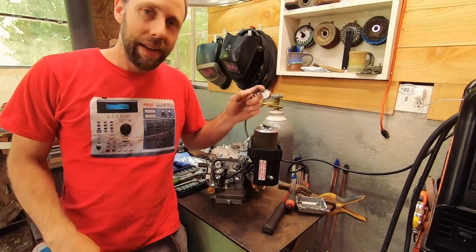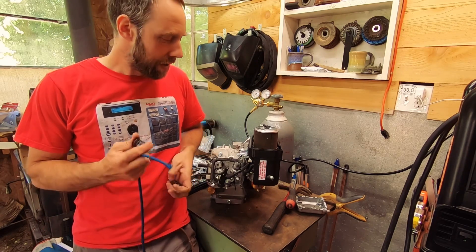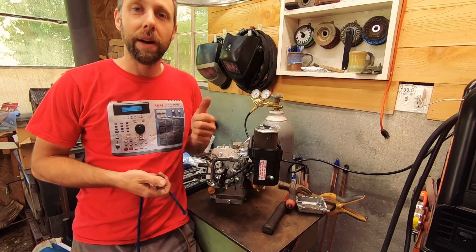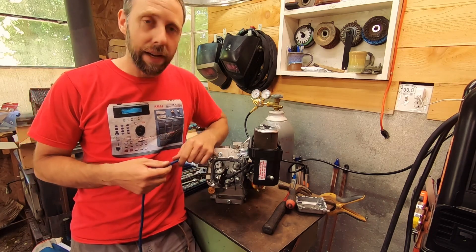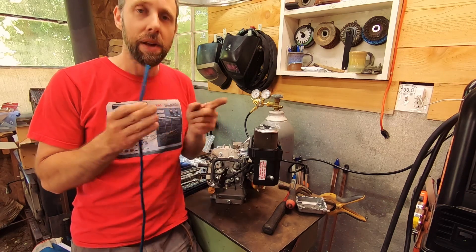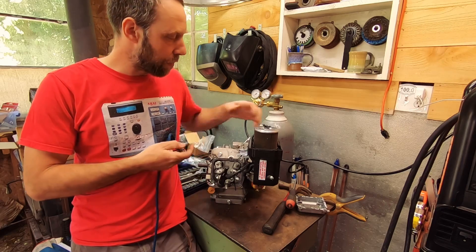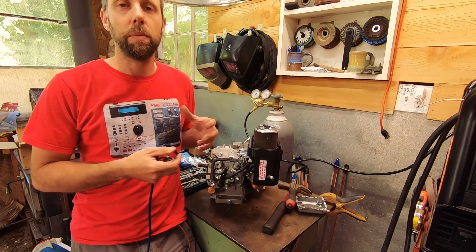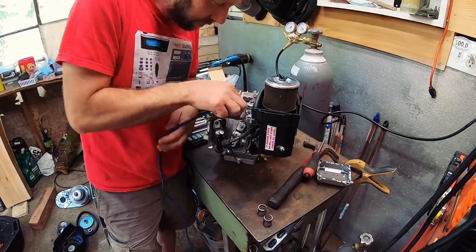A few people suggested 18-pound valve springs — I don't think it's a bad idea at all. Especially with pulling out the governor, we're going to be getting higher RPMs. So I'm going to put these in. I could pull off the head, and I might have to, but I'm going to go for the rope technique: take the piston to the bottom of the cylinder, put the rope in there, gently turn it over by hand, hold it there, and compress the rope up against the valves. Most of the time it works.